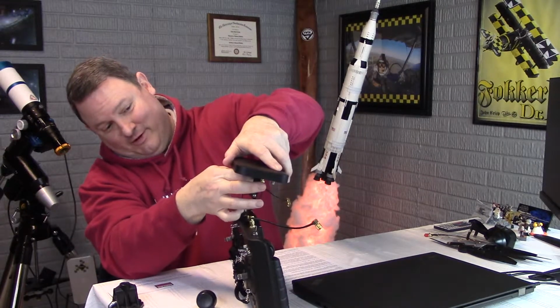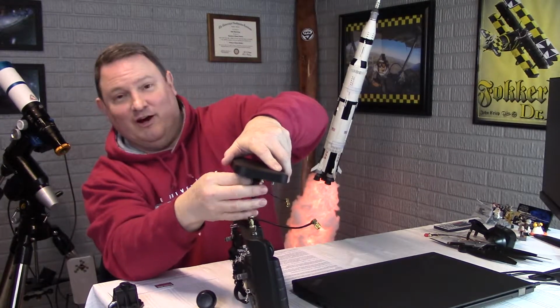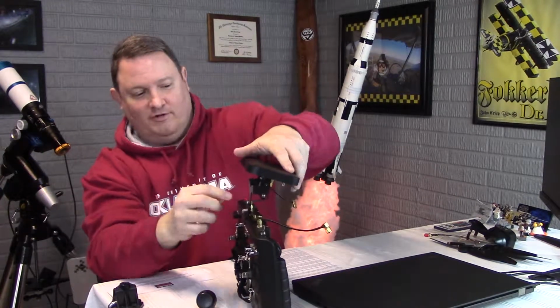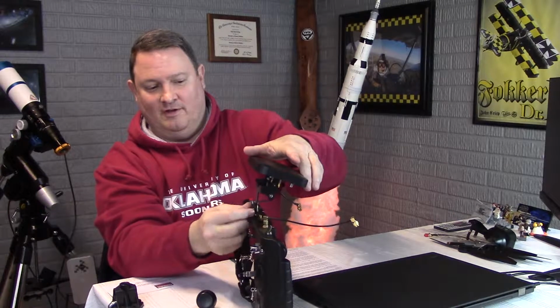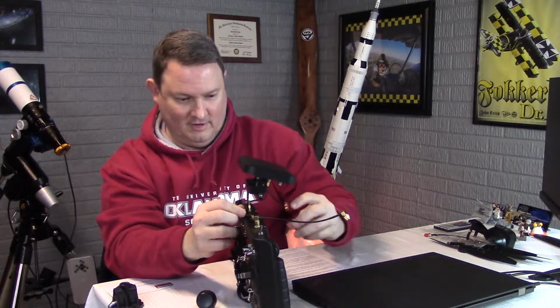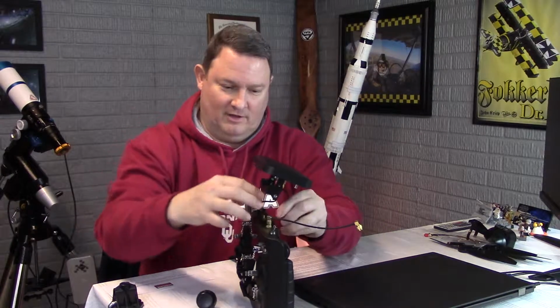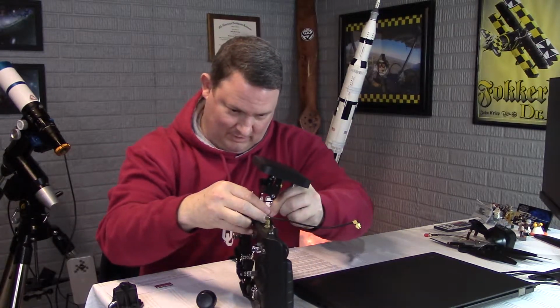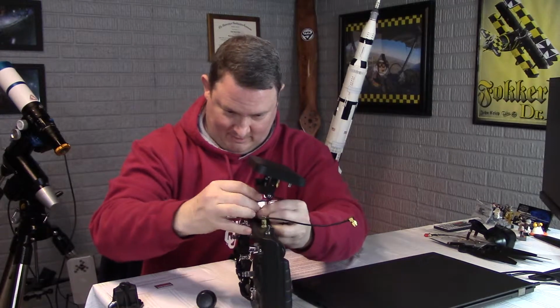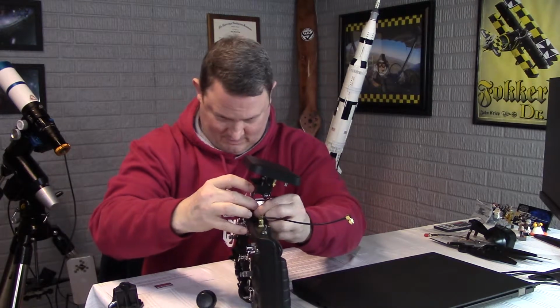And of course, this is a one-time thing. To take this off of the transmitter receiver, in the future, you unscrew the three base screws, pull the front screw off in the clip, and this all stays as one unit. And then it's just a matter of hooking these cables to the appropriate locations and tightening them, and you're done. And that's all it is.